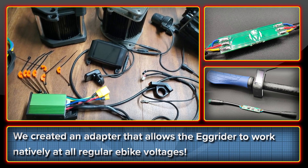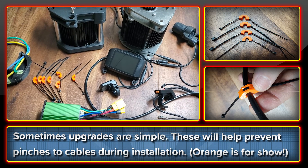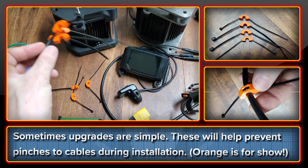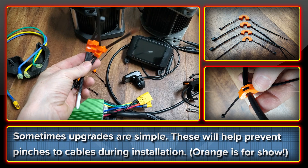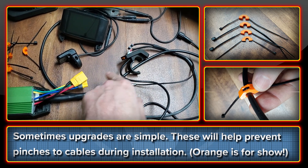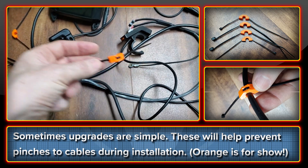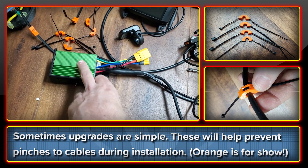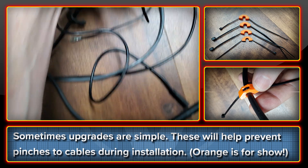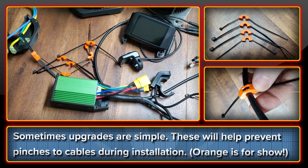You don't need an external switch to turn your bike on and off — everything works with the power switch there. Although the kits for the BBSHD are a pretty mature product, we are still looking for ways to improve it. Probably the simplest thing I've done recently was to make these wire protection pieces, because we had a few customers pinching zip ties and one even severed one of the wires. The wires in these harness connectors are quite small — there are like 12 wires going through these. Zip tie edges can be sharp and if one pinches into a wire it can cause all sorts of issues, including damage to the controller. So I've made a little piece that fits around any harness wires, and we'll have various different sizes to make sure it doesn't pinch into the wire. We'll make these available with the kits we send out.